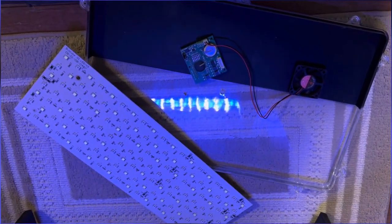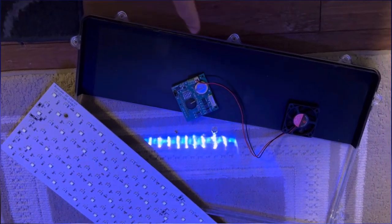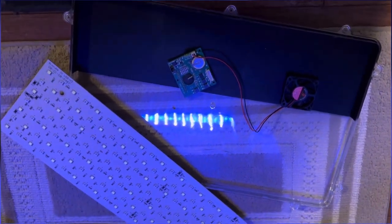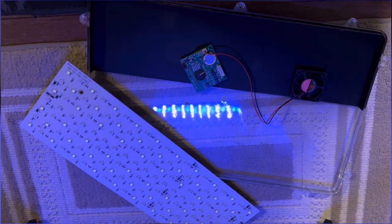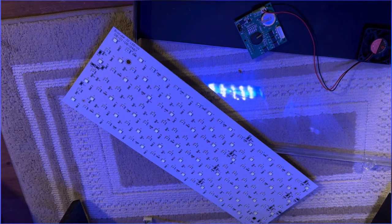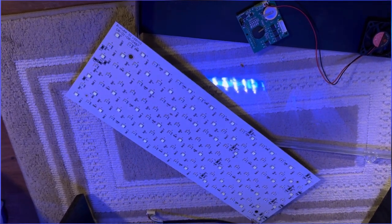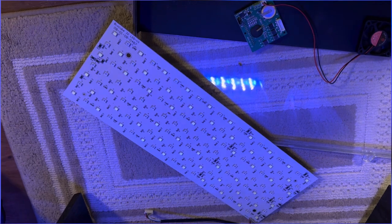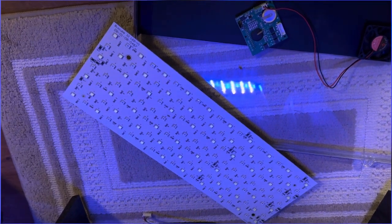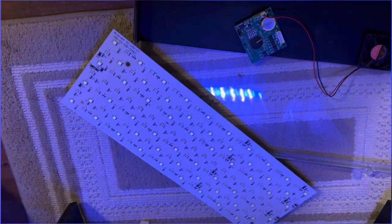Let's talk about what's actually underneath the lighting hood. If you remove 10 screws from the outside of this plastic cover and gently remove it, you'll be able to access the hardware underneath. The LED board itself has three different types of LEDs integrated into it and spreads across the top of the tank, which yields a very good spread of light. It includes a handful of reds, actinic blue, and bright white LEDs.